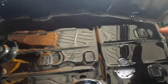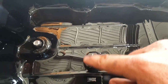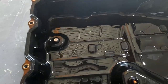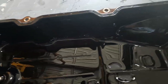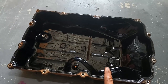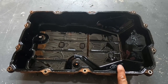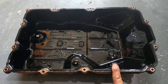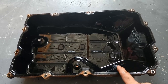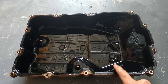I've drained the oil out of the pan. These are the little magnetic pickups that collect all the gunk and bits of clutch pack — and there's only the tiniest amount. The pan is clean, which is a good sign. I think that's a result of not flogging your transmission when you're towing, making sure you choose the right gear, and also having a trans tune, which optimizes your transmission. Good condition transmission, good condition oil — treat your cars right.